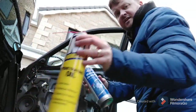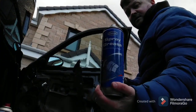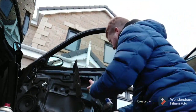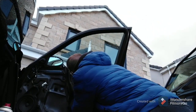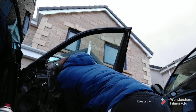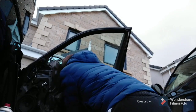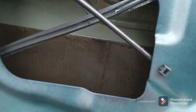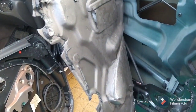I'm just using this to get rid of the moisture, and then this to keep it lubricated. I'm not being particularly precise — just spraying it pretty much everywhere inside. This is the reverse of the door handle mechanism. It's a bit difficult to focus on, but you can see in there — just slather it all. That should hopefully stop moisture forming on it and stop it freezing. Right, let's go and stick this door card's foam back on again.